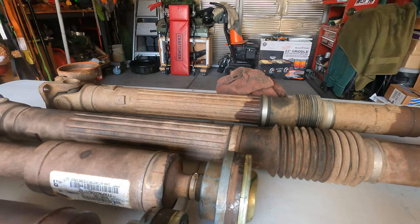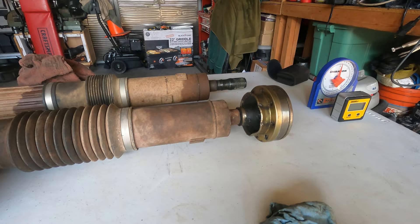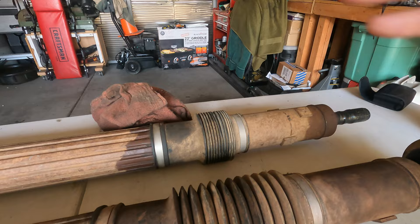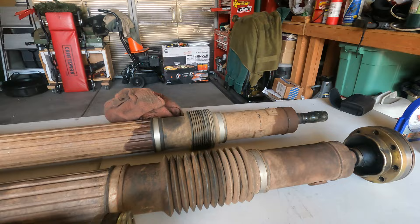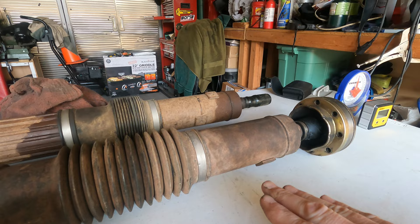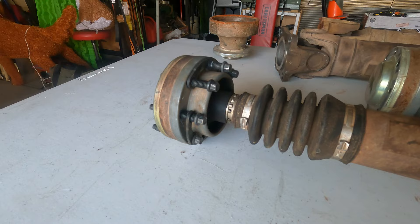It's not the golden bullet — it's not going to solve all your problems. One of the other solutions is to actually replace this drive shaft and get something that has two cardan joints — either a cardan joint or a double cardan joint, often called a CV joint — which we're going to talk about in a minute. The other issue with these drive shafts is that because the diameter of the shafts is so much bigger, they can make contact with the exhaust crossover pipe underneath when articulating down. The solution to that is exhaust spacer kits, which lowers the exhaust away from the drive shaft, or replacing the drive shaft altogether.